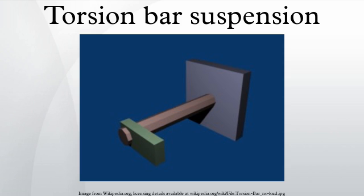The single torsion bar was mounted through the frame sides behind the rear axle and then attached by arms and links to the front side of the spring U-bolt plates. Axle flex was discontinued for the 1936 model year. The most famous American passenger car application was the Chrysler system used beginning with the 1957 model year, although Chrysler's torsion bar suspension was only for the front. The same basic system was maintained until the 1981 introduction of the K car. A re-engineered torsion bar suspension introduced with the 1976 Dodge Aspen introduced transverse mounted torsion bars until production ended in 1989. Some generations of the Dodge Dakota and Durango did use torsion bars on the front suspension. General Motors first used torsion bars on their light-duty pickup trucks in 1960 until it was phased out in 1963, where traditional coil springs were used up front for their two-wheel drive trucks.